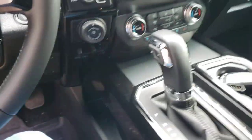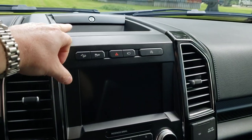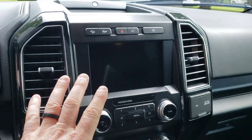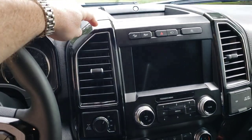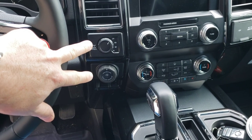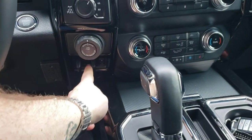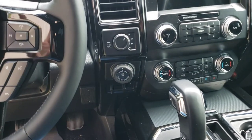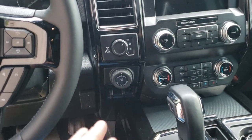This video isn't showing how to install the switch itself — there are plenty of videos out there, it's pretty self-explanatory. You pop up the infotainment fascia, undo two 7-millimeter screws, and that whole fascia around your infotainment screen pops out. Pull it out enough for clearance to remove the trim piece. Disconnect the two connectors behind it if you're four-wheel drive, pop out the dummy switch from the coin-slot cubby, disconnect it, and the new switch slides in — there's a groove on the bottom — then plug it in and reinstall.